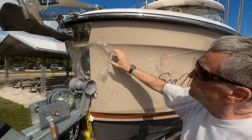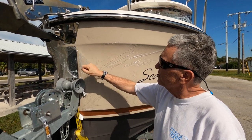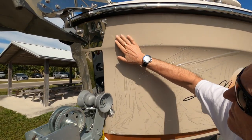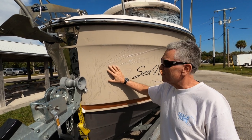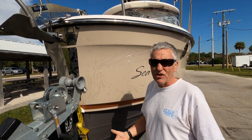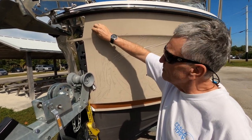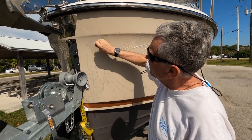What we also did is put on this plastic — it's heavier than saran wrap but fairly thick. It's a plastic adhesive that doesn't have glue on it, but it still sticks without leaving any residue on the hull of the boat. This is not going to stop rock dings — it's too thin for that — but it prevents the non-stop sandblasting from sandy roads. In wintertime you get a lot of sand stirred up hitting the gel coat. It'll also stop nasty road grime like oils from sticking, making it easier to clean.